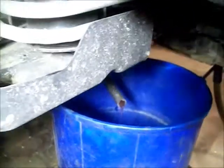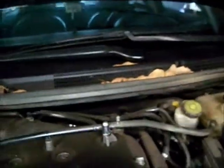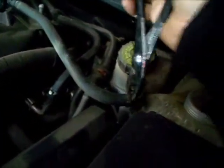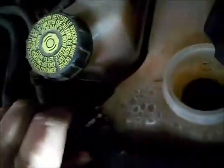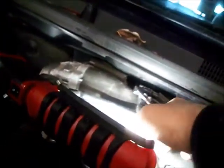Well, I got the drain plug loose on the radiator and antifreeze is draining. While that's happening, I'm going to go ahead and take this air bleed line off, or at least loose, across to the reserve tank. Well, that clamp is loose. It's kind of been leaking too. I'll probably change that clamp. Let's see what holds that evap line down in there.